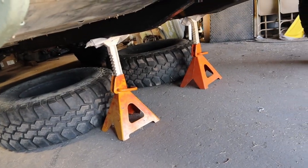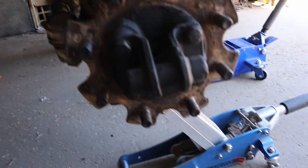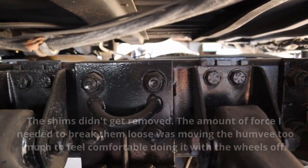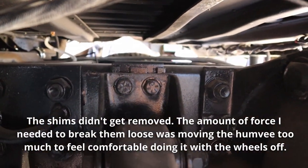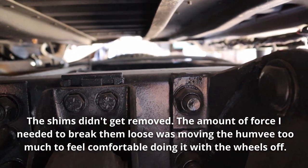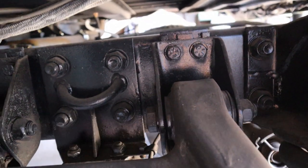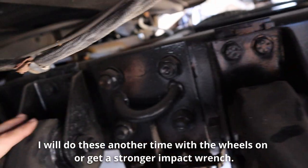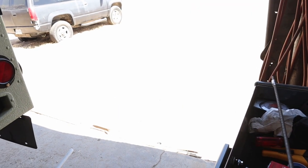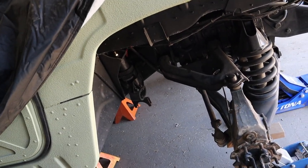We got the wheel and tire off. We do have jack stands under there, a jack on the back also, and I'm using this in order to put some pressure on the A-arms. You can see our shims in here — we have some pretty thick ones, so we're spaced pretty good. What we'll probably do is go ahead and take those out completely and tighten those back up. There are two bolts up top and two on the bottom on each of them, and they do have nuts on the other side.